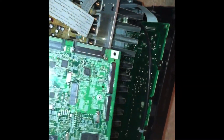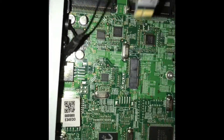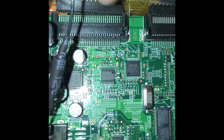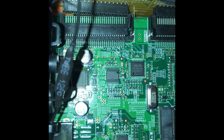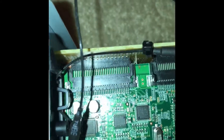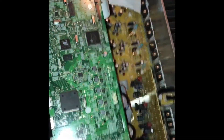I'm going to install the new board, pretty much putting everything together in reverse. I have the board aligned — it's not all the way in yet, just aligning the pins. Make sure you don't misalign these because the pins are very delicate. If you misalign it, the pins will bend and you'll damage your new card. Gently push it and don't put a lot of pressure.